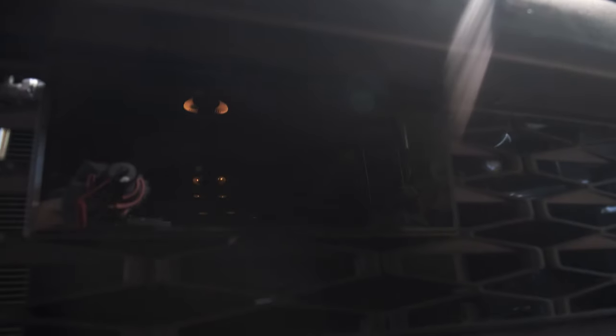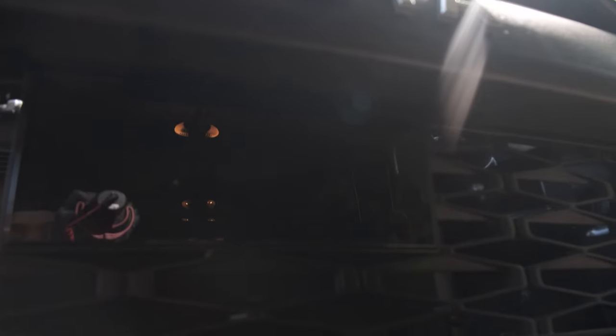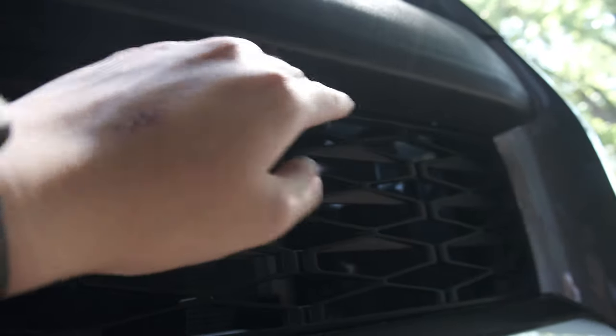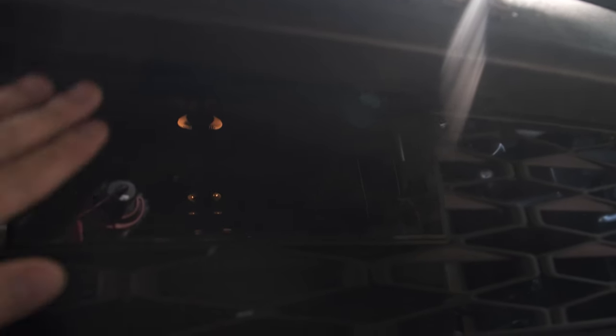The next thing you're going to want to do is cut a little clearance for the safety sense sensor. I did about half an inch on this side and half an inch on this side, grabbed a ruler, and just cut it straight across with a box cutter — shears would work fine too. I did a test fit first. This will technically fit right over your sensor, but because of the spacing, it's not going to allow your grill to sit flush. It's going to bump right next to the sensor and create a gap, so you won't be able to mount your grill as flush to the car as intended. So I cut out that half-inch on each side, which allowed me to bypass the sensor.